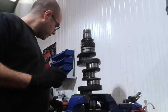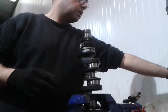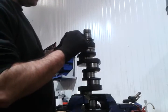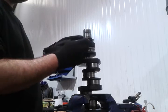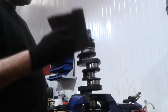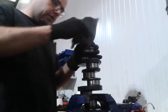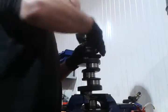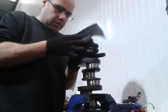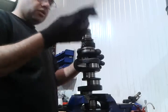I've already removed the circlip. Before I put my puller on the crank gear, I normally just clean up this area around here because it normally fills up with carbon, and it makes it more difficult for the crank to come out — and sometimes it scratches the crank gear. So I'm going to use a scotch brite to clean this up nicely so all the carbon comes out. It's going to be reground anyway so I'm not really bothered about the journal. This is a 1500 scotch brite so it's just a polish really.